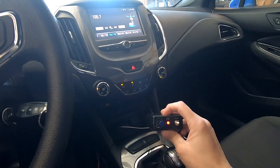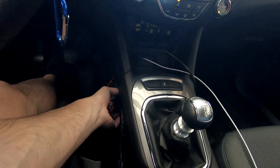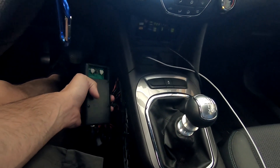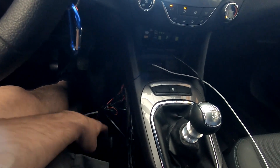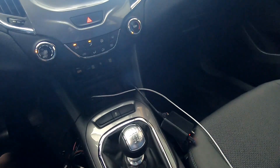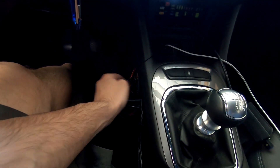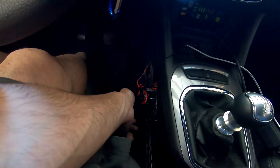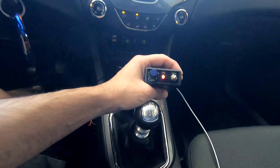I wanted to show you where I put the controller. I temporarily put the controller right here just for now, and the programmer for the methanol injection is actually under here. What I'll be able to do is adjust my turn-in and ramp-in. I need to do that on the fly for the first run, and then once I adjust those, everything else will be done through this controller. I decided to put everything in the transmission tunnel because I figured that was a good area for this stuff to be hidden. Once the wires are in — there's a bracket in the way — we can just take these two bolts off and get all the wires into the transmission tunnel, and then that can be hidden inside the panel. All you're going to need for your methanol is this little controller.